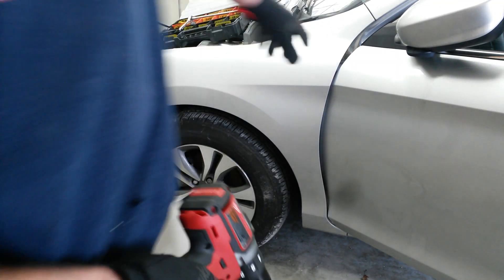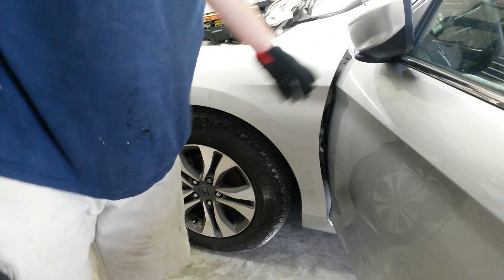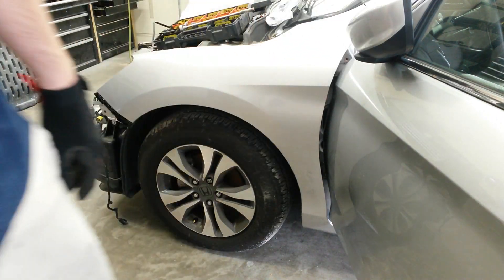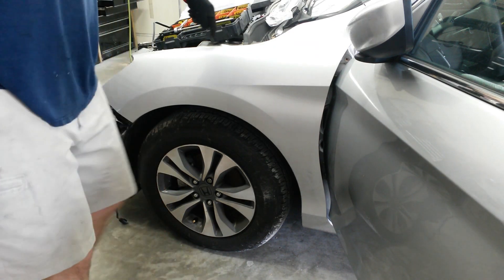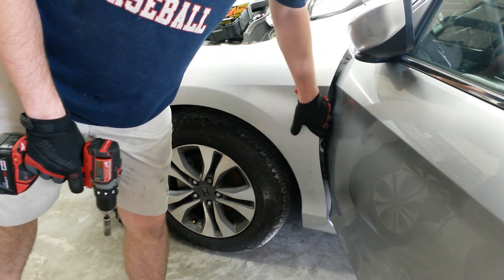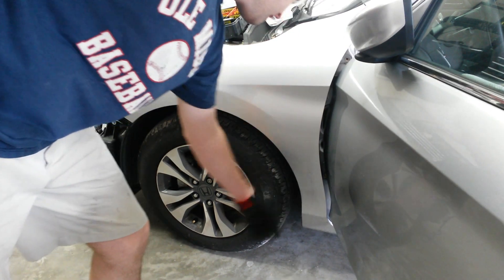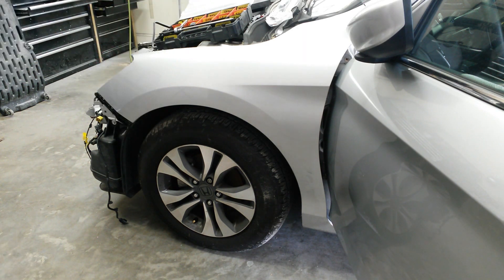I went ahead and took out the bolt that's in here with the door all the way open — I took that out just with a long extension just to get the handle away from the door. I'm real careful with that because I don't want to chip the door edge. The rest of them I'm going to take out with the drill. There's one up here, one towards the front, one down here, and one at the very bottom. Then there's a plastic filler in here that's hooked in that will have to be worked off as I wiggle it off the car, and there's a few clips in here.